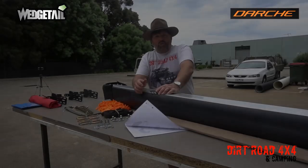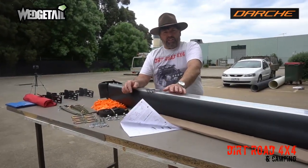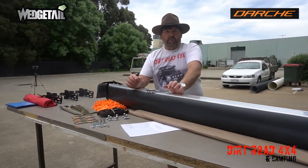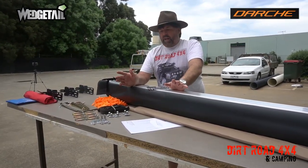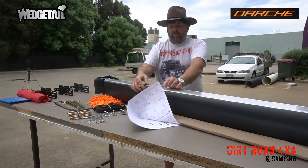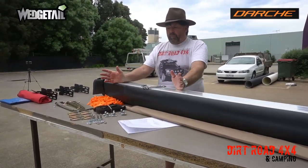I'm from Dirt Road 4x4 Central, and today we're going to do an installation video on the Darche Eclipse 270 on a Wedgetail roof rack. There's a couple of things you need to know before you start, whether you're going to put it on a Rhino or a different brand of rack. The tools you'll need to start off with: a 5mm hex key or Allen key, a 14mm and 13mm spanner.